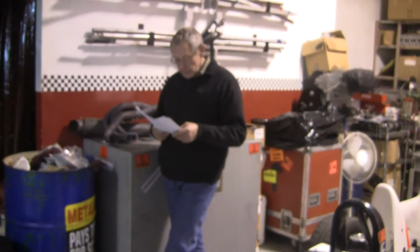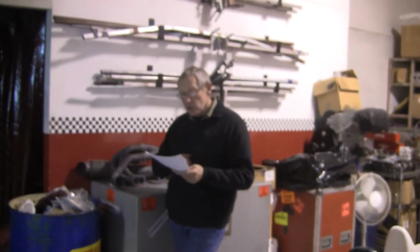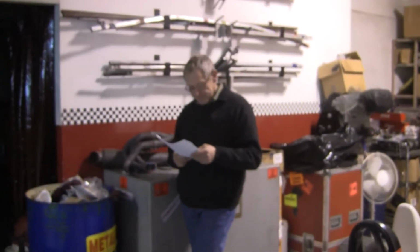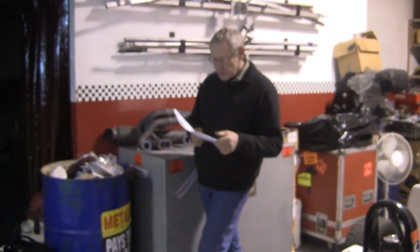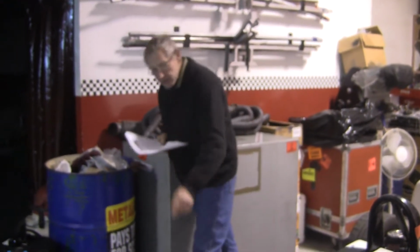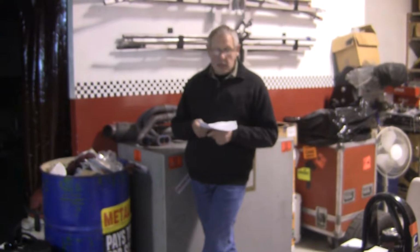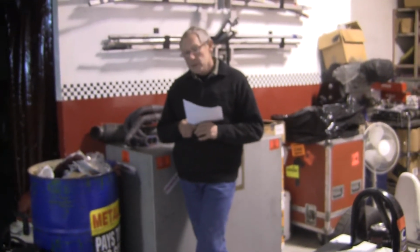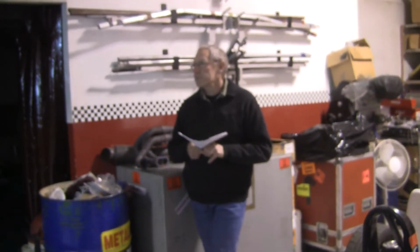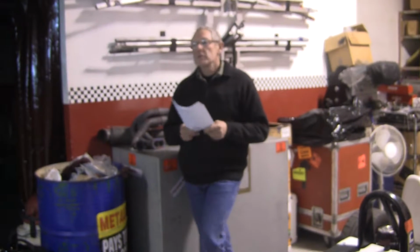And then we're going to move on to adjusting of the shocks. Anybody had to play with their shock absorbers? Yep. Confused myself. Okay. So the first thing with most of these shock absorbers, they've all got canisters on them. I mean, the rear that's got Bilsteins on it, but these Öhlins here, for example, there's a canister there, and it's got a valve on it that's got to be full of nitrogen. Normally 120 psi, up to about as high as 150. And it has a Schrader valve on it, but don't put compressed air in it. It doesn't work. And it's not good for the insides of them either, because the air is full of water. You end up with milky water in there. So that's not a good thing.